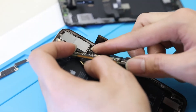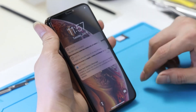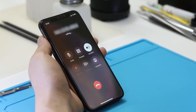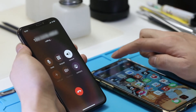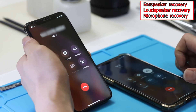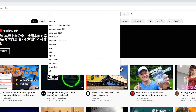Install it back to the iPhone XS. Connect all flexes and the screen back. Power on and insert the SIM card to test the telephone call function again. The ear speaker works well, and the loud speaker sound is big and clear. By now, the sound missing problem during telephone calls was fixed perfectly. What kind of motherboard repairing do you like to watch?